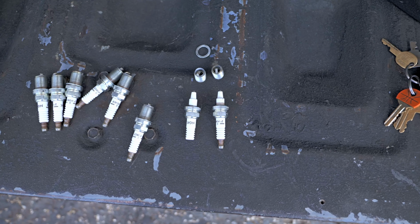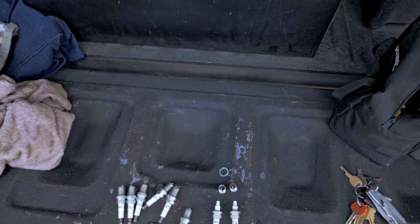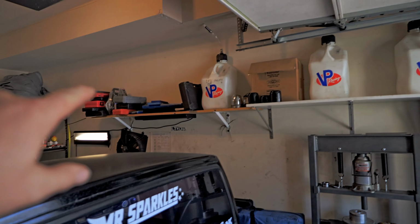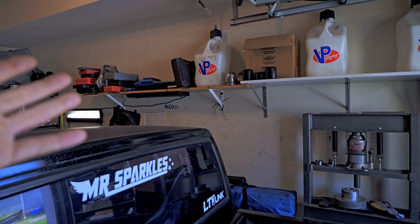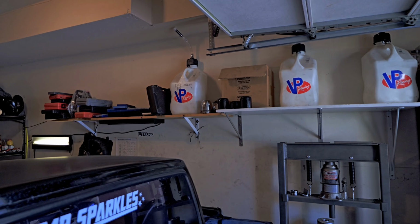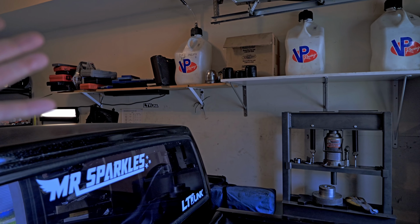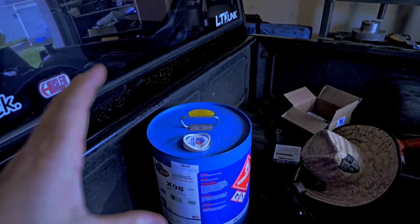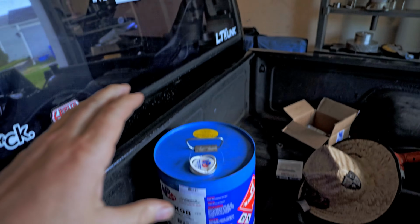Now there are some guys who run theirs really, really fat and it's living on E85, but here's my theory about that. On boost cars, on the pump stuff, which is, well right here, which is 15% gas. If you test it, if it's real E85, it's 15% gas, and the rest of it is ethanol. But the pump stuff, they usually mix with crappy gas, like an 87 or 93 pump, right? Now in boosted applications, this is just my theory, I could be wrong, you guys can call me an idiot or whatever, but on a boosted application, you're compressing all that fuel and it's igniting.